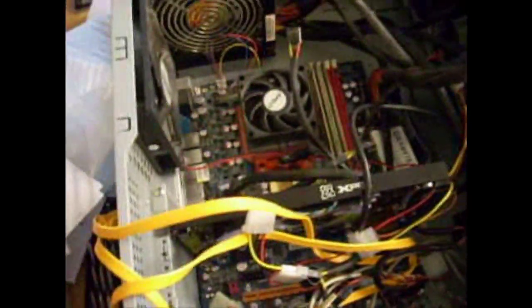and I'll say it again, make sure you don't have any static on you. You can de-static yourself by touching a metal faucet or a metal window or even a metal door in your house that is grounded. You can also buy an anti-static wrist strap, which costs just a few dollars, and it's worth the investment.